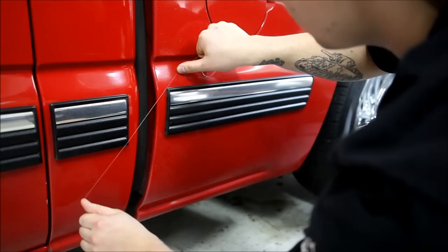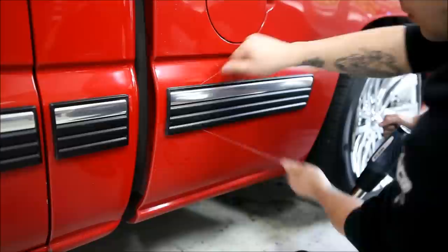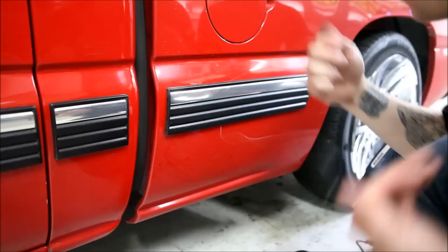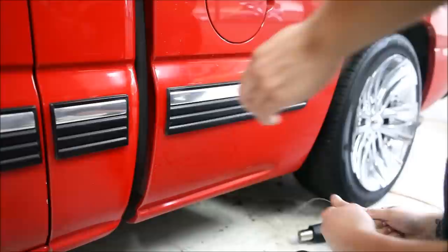Use a very nice sawing motion. Get it in behind the molding and just start sawing with a little bit of pressure — it takes a little bit of time. Wrap it around your fingers and through she comes. I put about two minutes of applying heat to this, so take your time and be very patient. If you get it too hot you'll actually dig into the ABS and start to cut it, which is not what we want. It does come off in almost a rubbery form — you'll see when you do it.